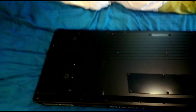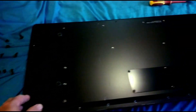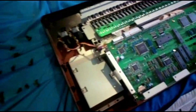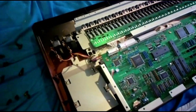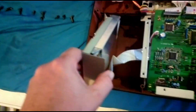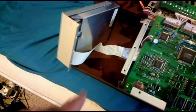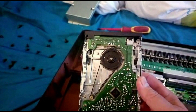Simon's done all this himself — I can't take any credit. We have a Yamaha SY85, just turned it upside down because we need to take all the screws out of the bottom. All the screws have been removed, put them in a logical manner, and take off the back cover. Here's the inside. Now we're going to go over to the left-hand side and take out these four screws — but first, a screw there and a screw there. That gets the drive out. Carefully take the four screws from the top, which releases the disc drive, and carefully take the ribbon connector out.